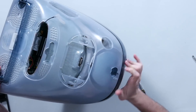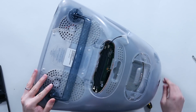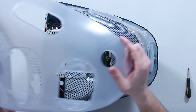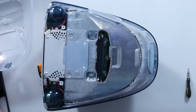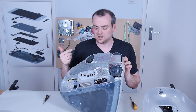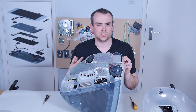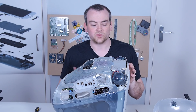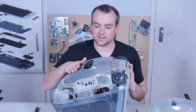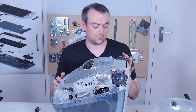I didn't even know this had an external VGA port — hidden that well. I can't say I've ever known anyone to use it. It's fair to say there's a lot of what I'm assuming is RF shielding, because the computer being in a plastic case adjacent to the CRT would have introduced a lot of noise. Most PCs, of course, have a metal case which shields them from electromagnetic interference. So the fact they've had to introduce this cage tells us a lot about the construction.